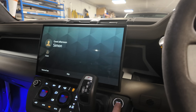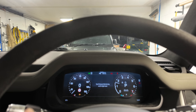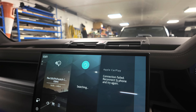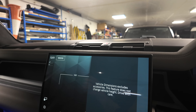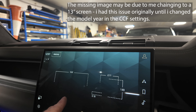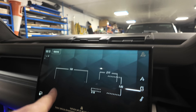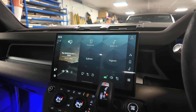Last moment of discussion before we leave - is that a good place to put the infotainment two-and-a-half-thousand-pound control unit on an off-road Land Rover? George says no - in the boot would make more sense, or in a side wall. Maybe not great. Final check - all back together, all the seats back in, everything's good, no faults. Just have a look if it's got all the dimensions back. Oh no - I'll have to work out how to get those back. I think it's because I've changed that model year to 2020; I'm going to have to go to 2023 and then back to 2020.